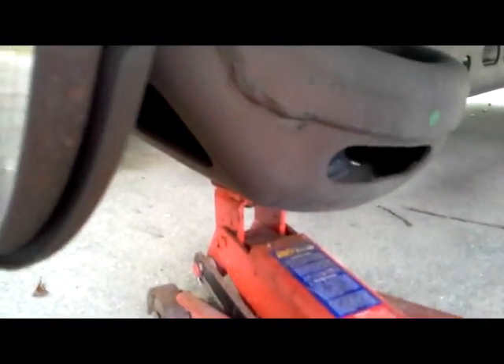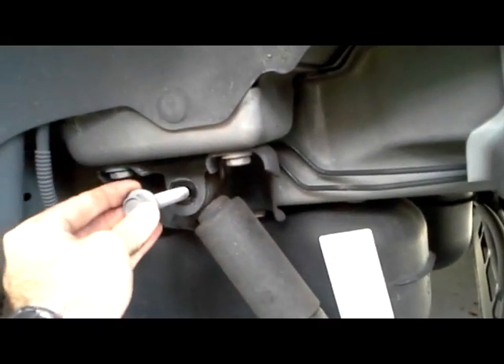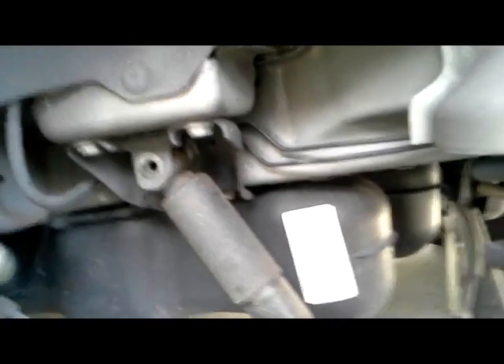What I found out is that you have to jack up the body and also support the trailing arm, otherwise the trailing arm is going to fall down. There's a bolt here and a nut behind it — you use an 18mm socket and wrench.